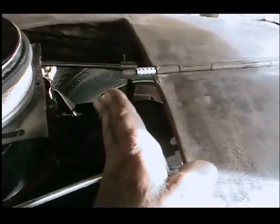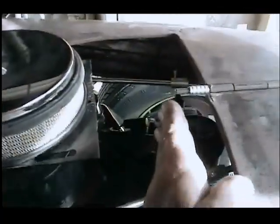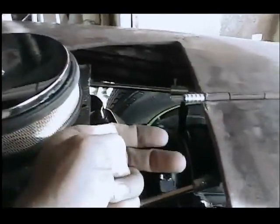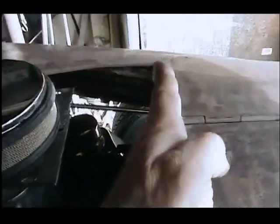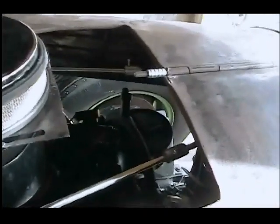And the angle iron will give me rigidity this way, because it's a right angle, right? It'll give me strength this way and this way. But this surface here will give me something to bolt on when it comes up to the piece up here. You know, see what I'm getting at? I need something for this top piece to bolt to, so that when I unbolt it, this whole piece here can come off if I have to take the hood off. So that's my train of thought, and that's what I'm trying to get at now.